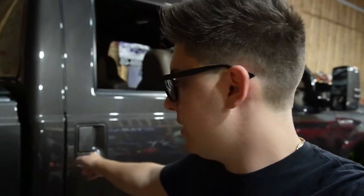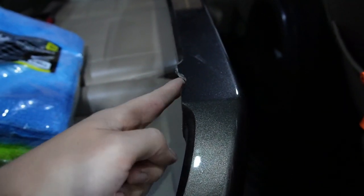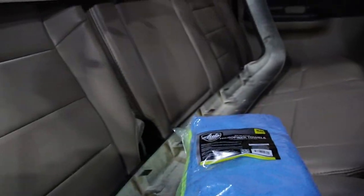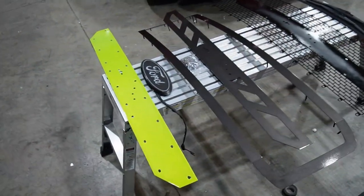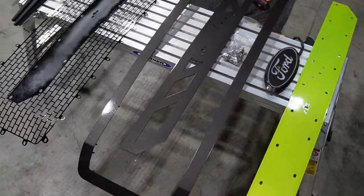To install this grill, you're going to take your factory XLT style grill — and if you want a paint match, of course you'll paint match it. I have mine in the back seat right now. You do have to cut these center pieces out on both sides, remove everything off the back side, and then what's going to lay inside of that is our grill from Boost Bars.